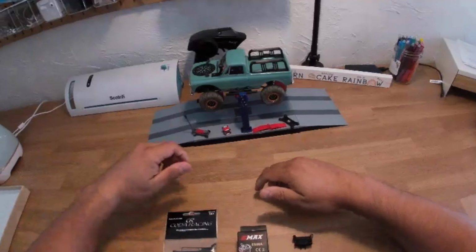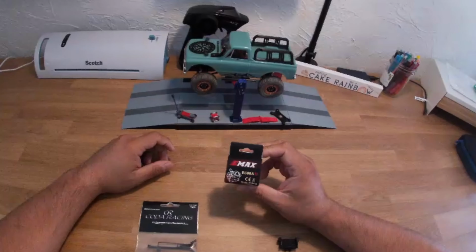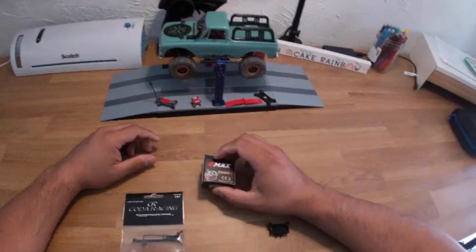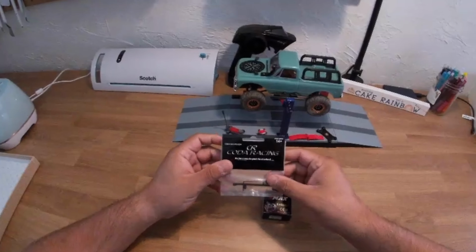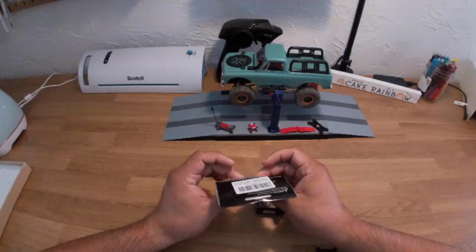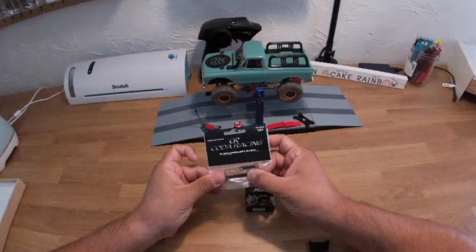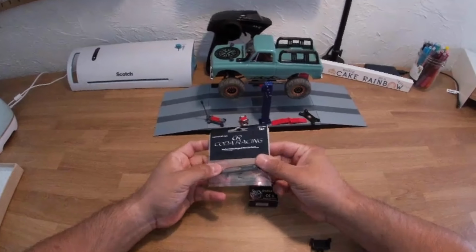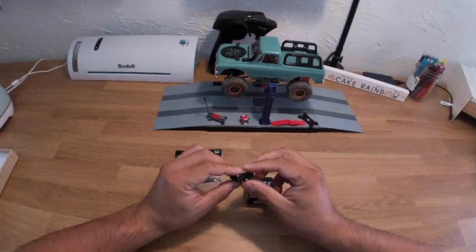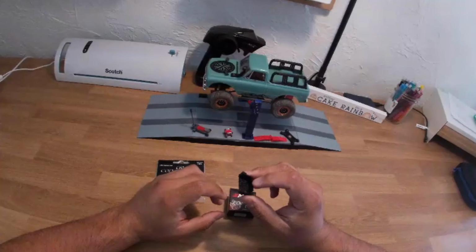In today's video, I'm going to be installing this Emax servo here. It's an analog one, it's not digital. I've seen a lot of people use them online. I do have the Coda Racing steering links. They are aluminum, same as the links that I use for the vehicle. So it looks pretty cool, looks pretty strong and decent here. And I also have this 3D print servo housing from a good buddy of mine who 3D printed for me. So this is gonna go onto here.